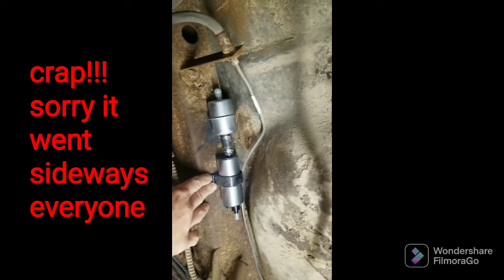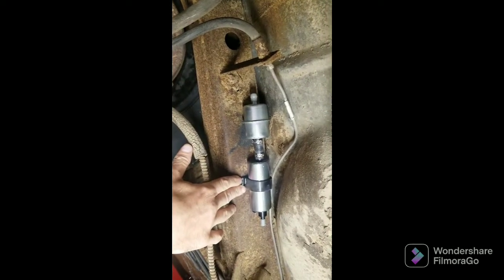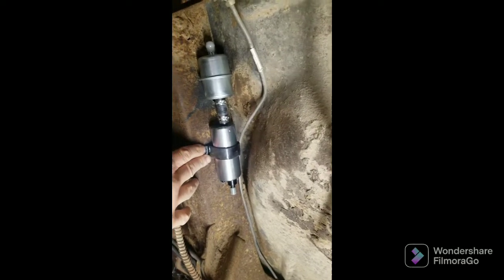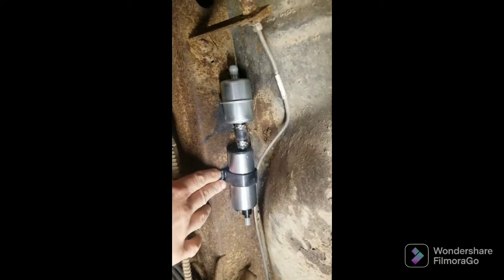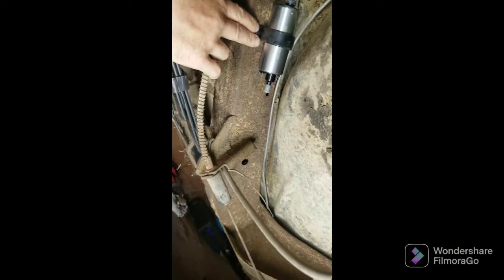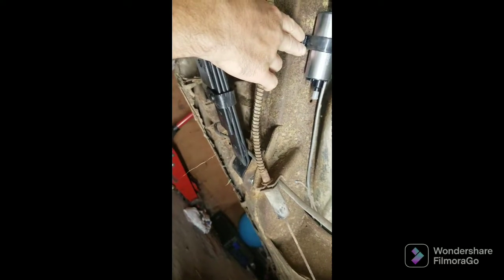All right, I think I found the location. So the hose will go right up there over the brake retaining bracket. I'll still have enough line I can run a piece of hose to the hard line and straight over the leaf spring right there. Can't see how it's looking, but yeah, it'll be fine. Or worst case scenario, I can go where the brake line goes and go over.